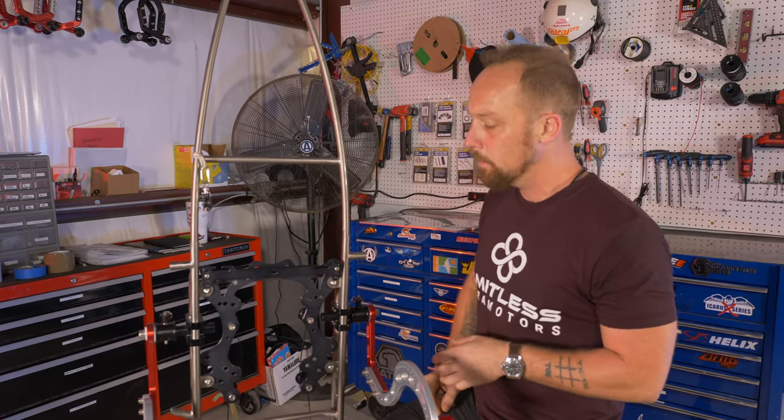But what that's gonna do is, because that is lower on your back, you have more mass up top here, where up here, not as much mass. So that's gonna assist you in your weight shift when you have it down lower. You can also bring your shafts out that much more, and that's gonna give you more weight leverage. And then you can configure your torque compensation into that as well. So you can offset it, you can widen it, but still offset your weight so you have that torque compensation, but also more weight shift authority because it's out further from you.